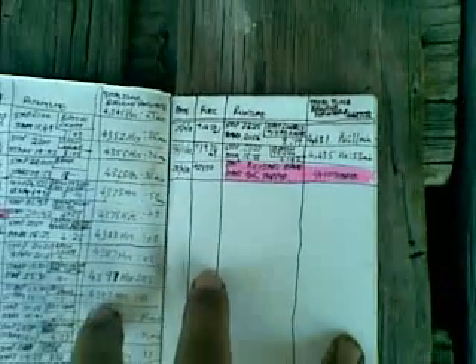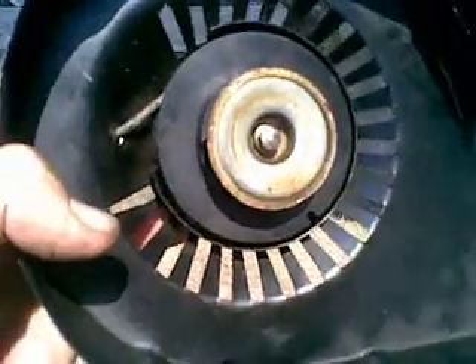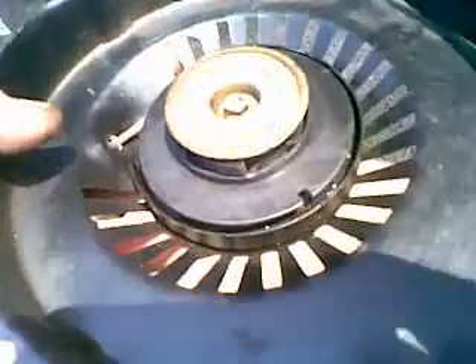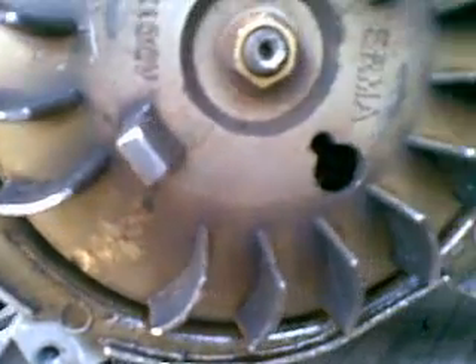When I went to start it a couple of days ago, it cut its starter cord off and then tied its recoil spring in the ends of the centrifugal fan blades on the flywheel.